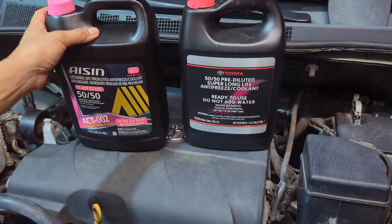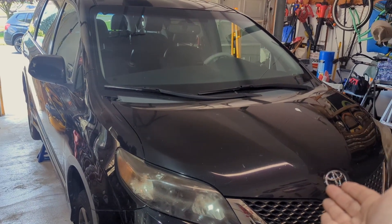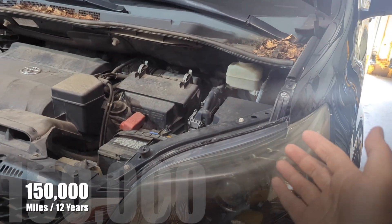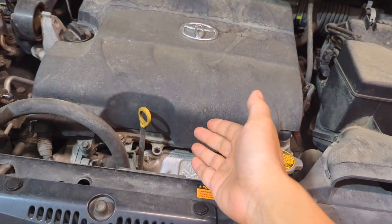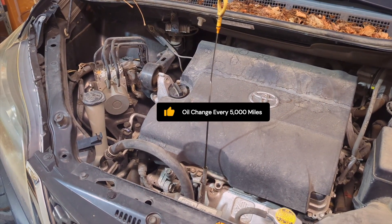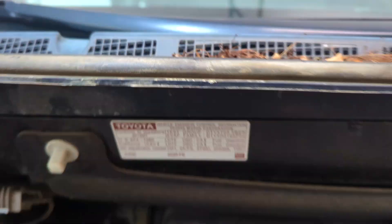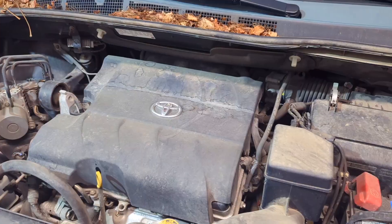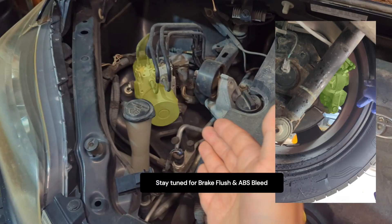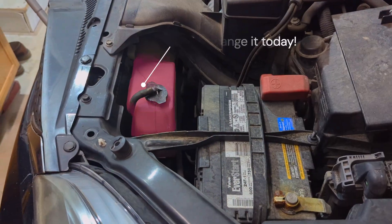The pink coolants are equivalent. This vehicle belongs to a family friend — they bought it used. At 150,000 miles, the service history shows regular oil changes every 5,000 miles, which is great. This is the 2GR-FE engine, a great V6 by Toyota. But there's no record of transmission fluid replacement, no brake fluid or ABS fluid service, and no record of engine coolant replacement.